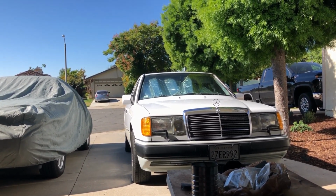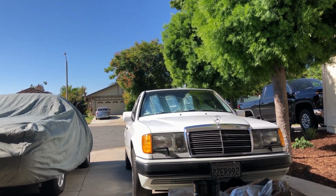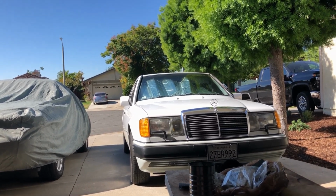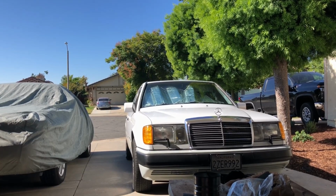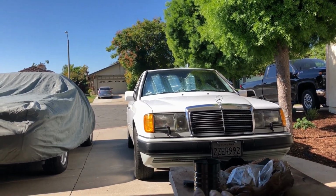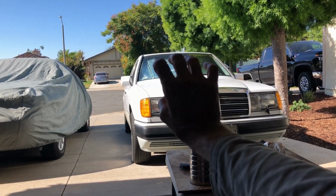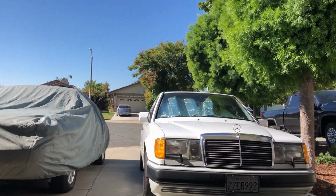We had a previous owner on this, and who knows, and this thing's blown quite a few head gaskets due to overheating, probably because these fans have never worked on high speed. The high speed cools it down really quick. So today I'm going to attempt to open that connector and move everything down one notch, then pull the electrical connector on the coolant sensor, turn the key to 2, and see if that solves the high speed. And that's what I'm going to be doing right now.